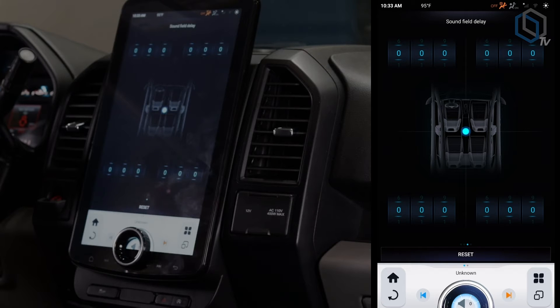Our next page is the stage setting — this one's kind of cool. For anybody that's played around with time alignment: a very elementary explanation is that speakers move in and out, that's how they create sound waves. Depending on where you are in that wave is how your ear hears it. In a vehicle, a lot of times you're closer to one speaker than another, so you might have one sound wave at its peak and another at its valley, giving you an out-of-phase sound.